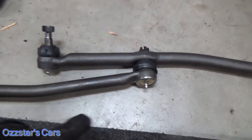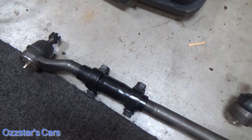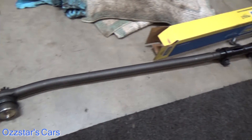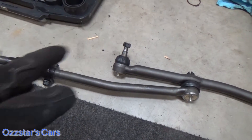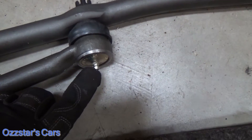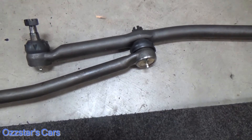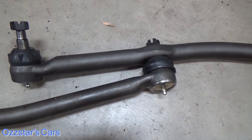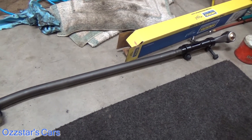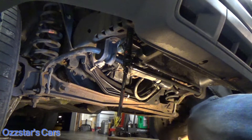Some prep work I did before I took the old one out: I took some measurements — like from the center point to the driver's side center of the outer tie rod end, that was 24 and a half inches. I took a tape measure while the old one was still in, so I have an idea of where it's got to be. You're going to need an alignment done to set the toe in or out, so it's going to need alignment — it also got new ball joints, so it needs one anyway. I also put all the grease zerks — grease fittings — in and tightened them down with a 7mm quarter-inch drive socket. Every one of those now has their grease fittings.